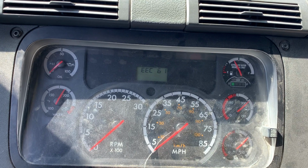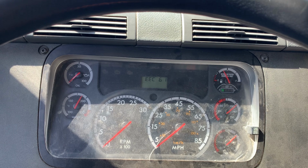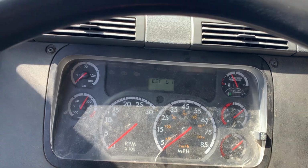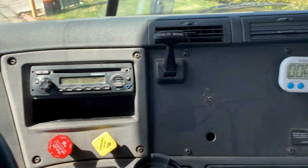All right, my needles have settled at 100 PSI. I will continue to hold down my service brake for 1 minute. During this minute, I cannot lose more than 4 PSI: 3 for my tractor and 1 for my trailer. My minute starts now.